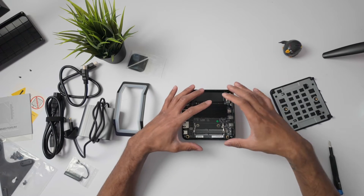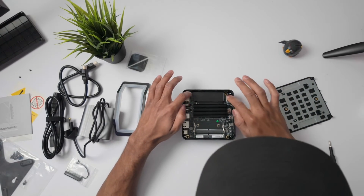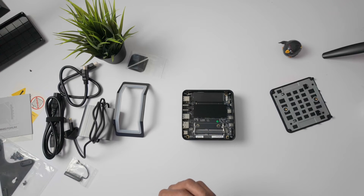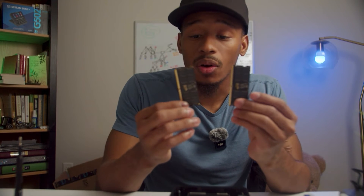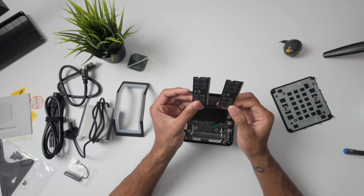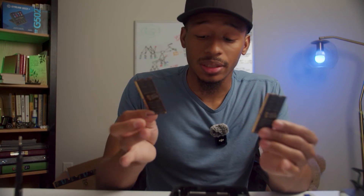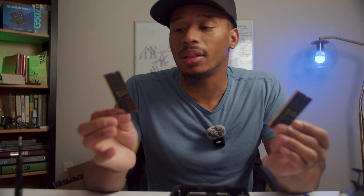I really like how they have it set up. The CPU is not upgradable, and from this initial board you don't have access to the CPU. So you don't have to worry about voiding the warranty unless you pop off these extra four screws and get access to the other side where the soldered-on motherboard would be. I'll go ahead and screw in the screws to this heat sink. Now I have two 32GB sticks — 64 gigabytes of RAM total — that I purchased from Crucial. They are 5600MHz, which is the wrong speed because this server actually only supports up to 4800MHz. But nonetheless, they still work.